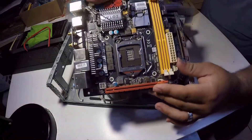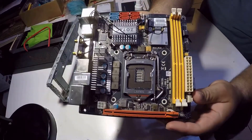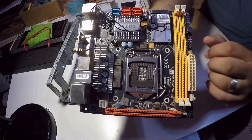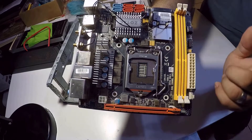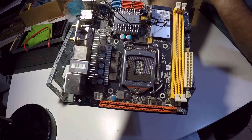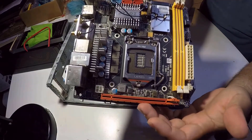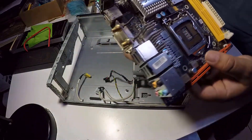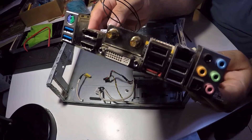And for the last part, the motherboard. We'll be using a Zotac H67-ITX-CE — a mini-ITX second-generation Intel Core board with an LGA-1155 socket. It has a few years on it but good performance. It runs DDR3 memory at 1333 MHz and can hold up to 16 GB. It has Wi-Fi, plenty of USBs, HDMI, and DisplayPort.